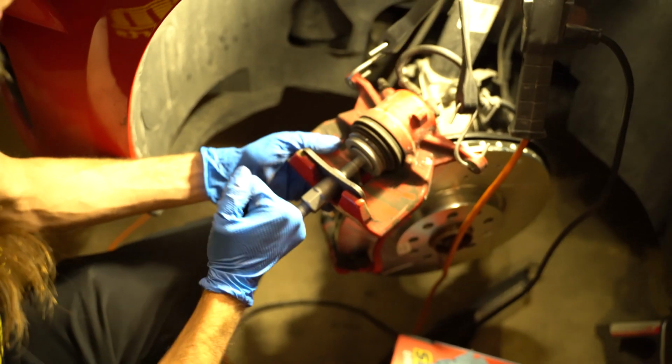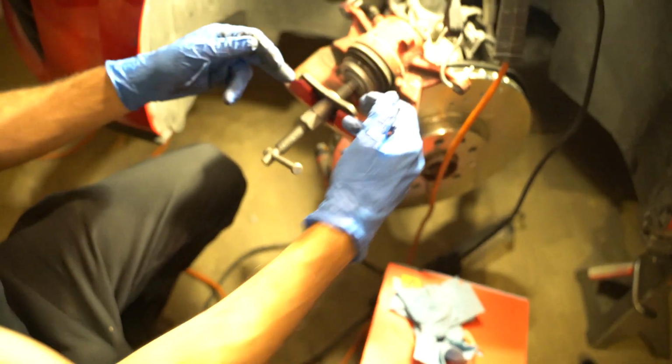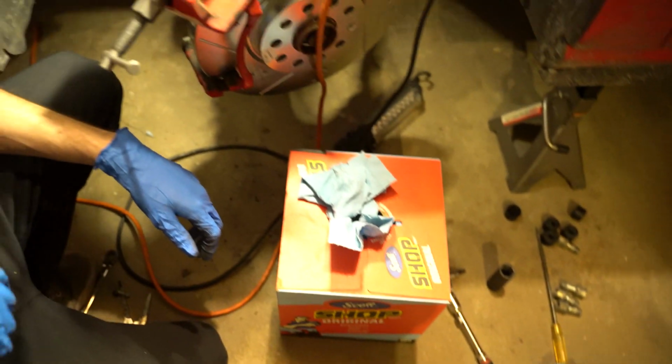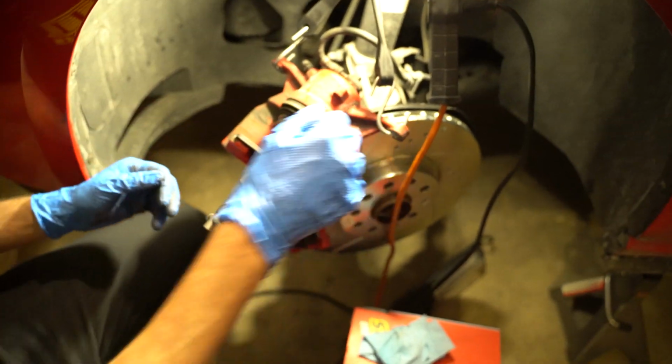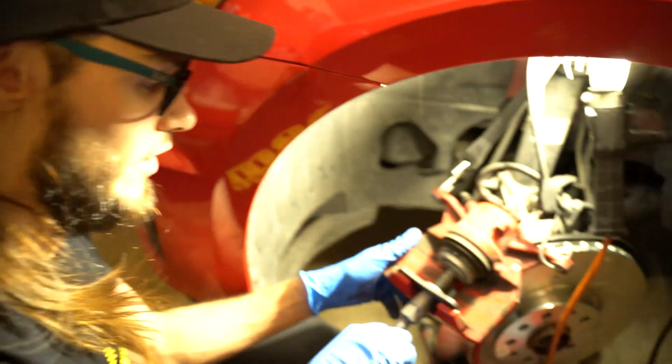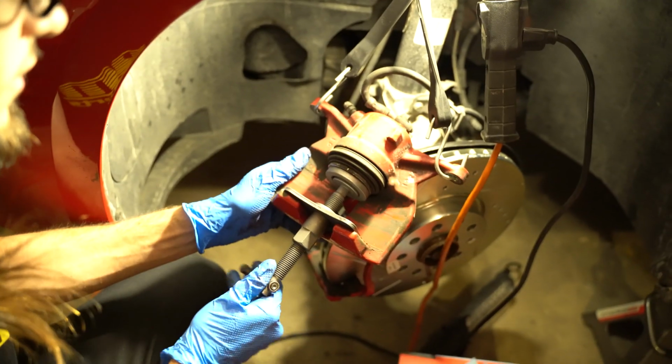So what's the reasoning for this? When you put the brake pads on, because this is right now used to the little bit of brake pad that was on the old ones, yeah? So you put the new pads on, you won't be able to get it past the rotor. Oh. So that's why you gotta push this in all the way, and then once we do all of them, you gotta pump the brake at the end so it matches to itself. Got it.